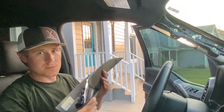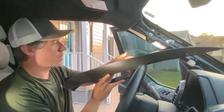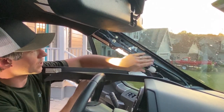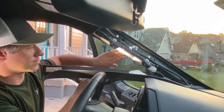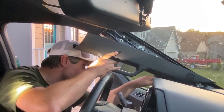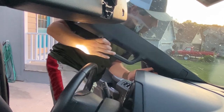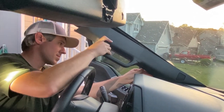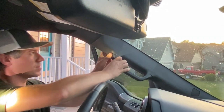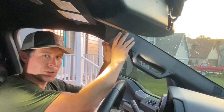The last steps to this video are reinstalling your A-pillar. First you need to plug in the speaker. Double-check that your cable is retained in the clips and out of the way of the airbag — we do not want to cross over it. Same thing with the speaker cable. I'm going to line it up, put these clips lined up in the front, line up our top clip, and once seated it should just push right back into place. Make sure you're tucked in along the weather stripping on the outside.